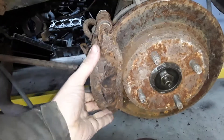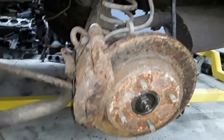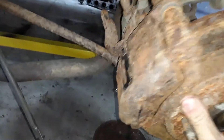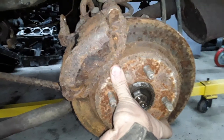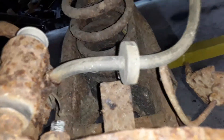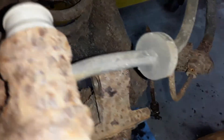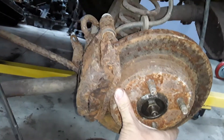I've got these two pinched together pretty good, so the caliper doesn't really want to come off — that's fine, it's just for mounting purposes so I can see what clears and what doesn't. If I put this on all the way, you can see that the caliper doesn't quite clear this trailing arm or control arm as it sits. So when you mount these, you'll have to position the caliper somewhere between the 10 o'clock and 11 o'clock position — probably closer to 10. We also have a strut that goes straight up in that mount that we'd have to deal with, so it's a narrow window, but it's big enough to actually make use of this.